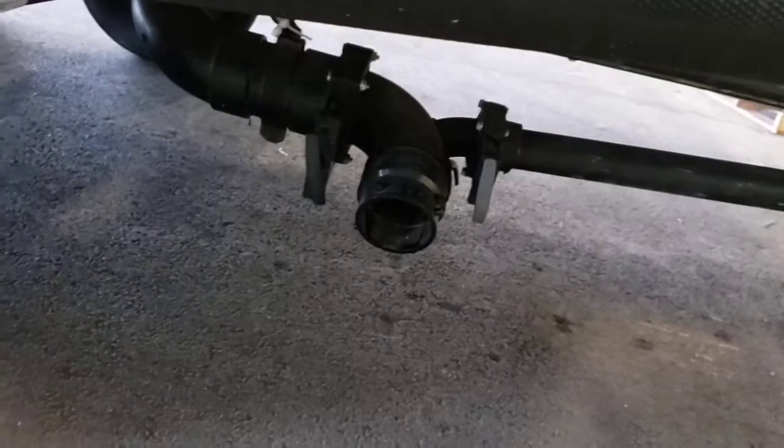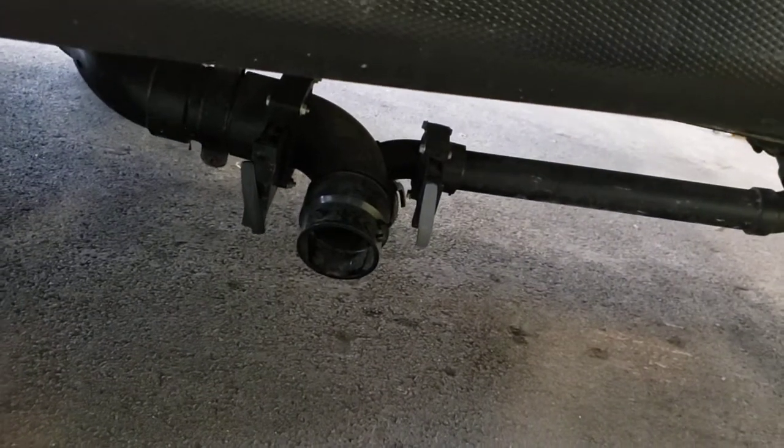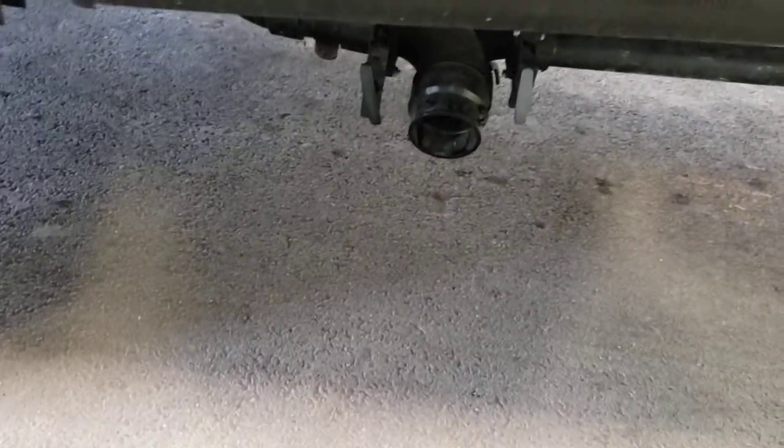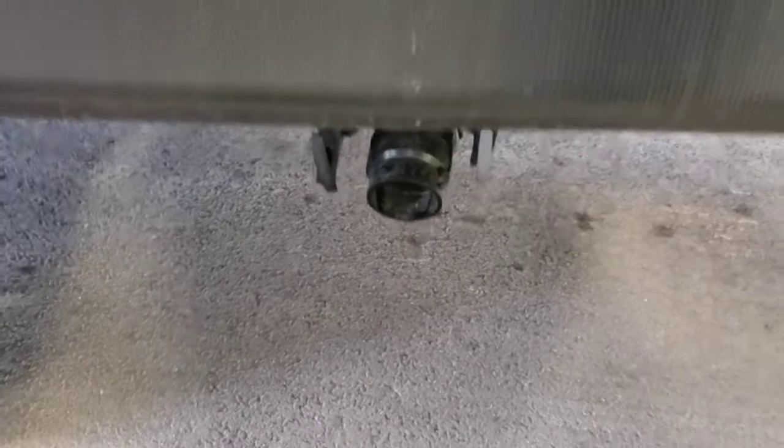Right here, your black tank and gray tank dump area. Right there, the one on your right is gray, one on your left is black. It's even nicely labeled here. Gray tank is your shower and sink water. Black tank is everything else. And then I always tell people, make sure them valves are closed when you're not using it so it doesn't drip out onto the ground, get you in trouble at the campground or whatnot.